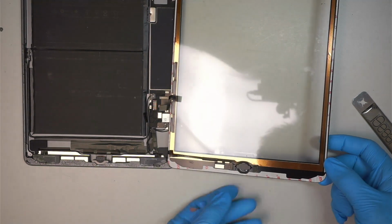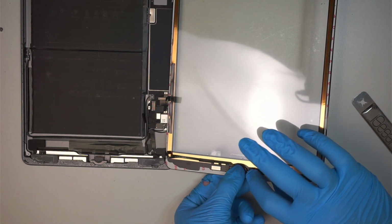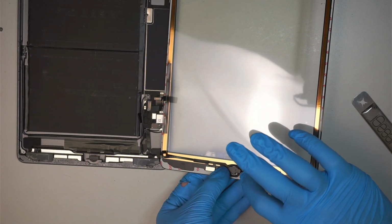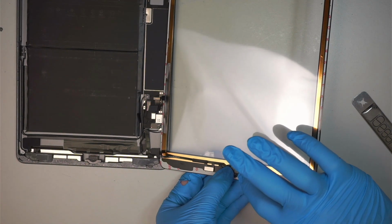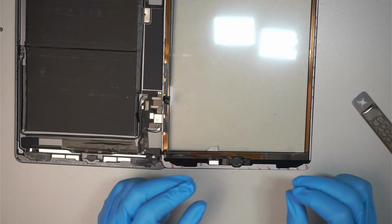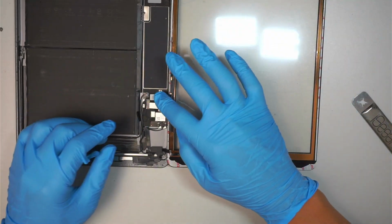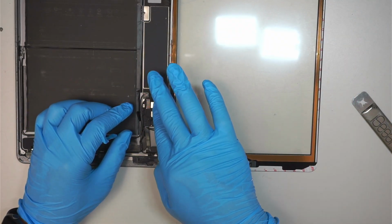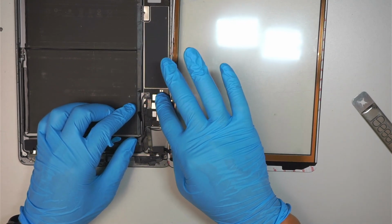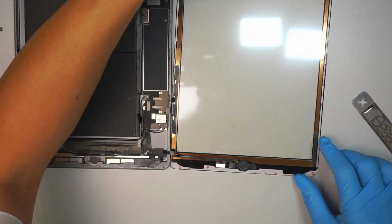All right, again, double checking. I wanna come back, waiting for the bracket to harden with the glue. I'm using my other finger to sense the click. As I'm pressing, I can feel the clicker is good, so I'm just gonna let the thing sit and get hardened. Alright, so while we are waiting for that, let's go ahead and reconnect that LCD, let's reconnect all this cable. Okay, they're just like Lego, you need to align them in the right position and then just press it in.